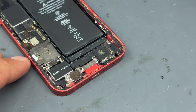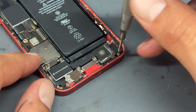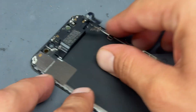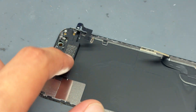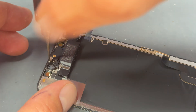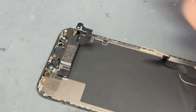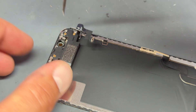With those four screws reinstalled, we're going to move on to the ear speaker. It's a little bit trickier, but nothing you guys can't handle. The best way to do this is by leaving the sensors attached to the screen, but you do need to remove the two tri-wing screws on the left side of the speaker. These are all different sizes so keep them safe, and then there are two crosshead screws on the right side as well.